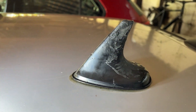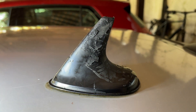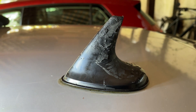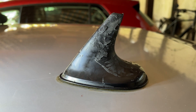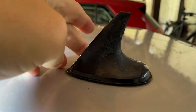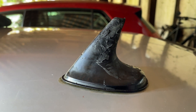I've now got it completely peeled off. I highly recommend using a heat gun just to loosen the adhesive, otherwise it's really difficult to get off. I also wiped it down initially with some WD-40 just to clean up some of the remnants, and then with some rubbing alcohol. I'm now going to get some silicone and just put a little bead around the edge to make sure there's not going to be any water getting into the roof.